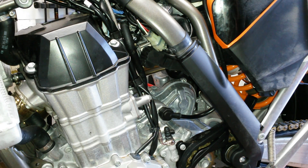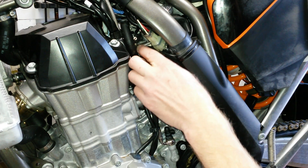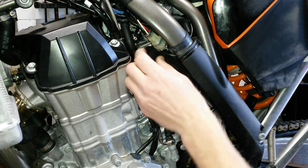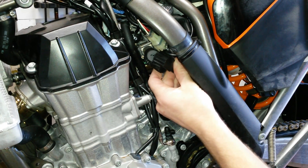You do not have to remove your gas tank to do this, especially if you're using this harness, but I removed my gas tank just to make it easy to see with the camera. The first thing you're going to want to do is remove the plug from the throttle position sensor on the side of the throttle body — it's this boot right here. Messing with this rubber boot is going to be the most difficult part of the whole procedure. Getting it off is easy; back on is a real stinker.